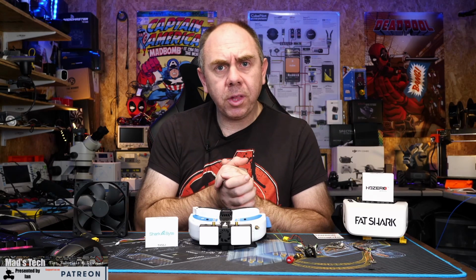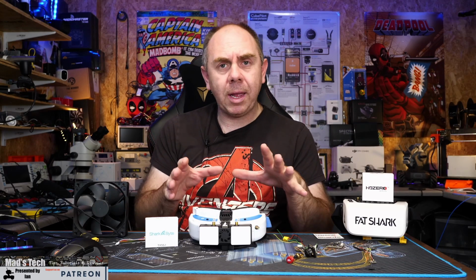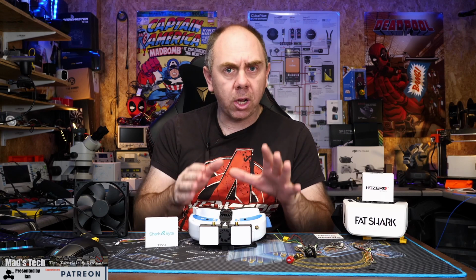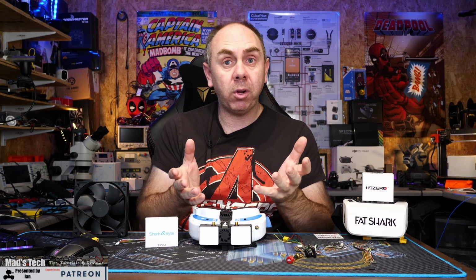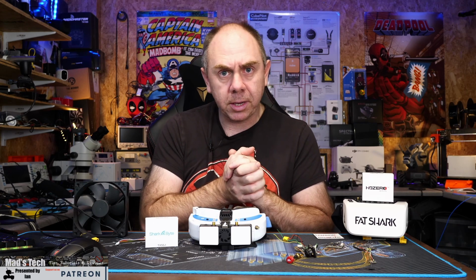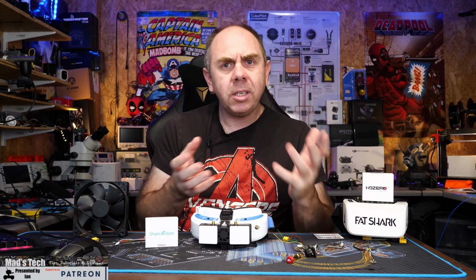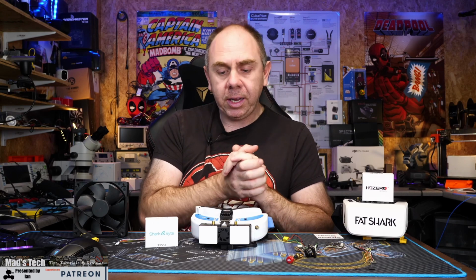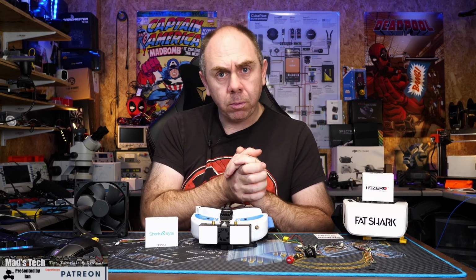Just a couple of other little things to mention before we get started, and one of them is around the battery. Just make sure that you are updating the firmware on your module with a fully charged battery. It just helps reduce the risk of something going wrong, such as the battery going flat partway through the process. The module update usually takes 5 to 10 minutes, so you do need to make sure that there is plenty of power in the battery you're using and it isn't going to go flat halfway through.